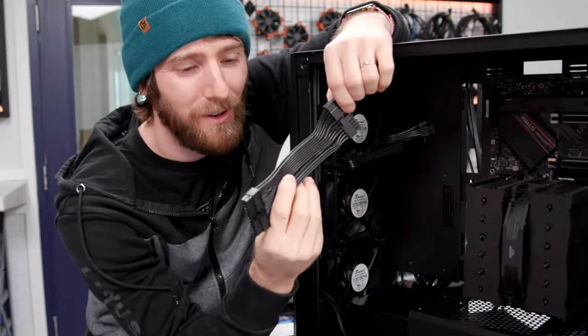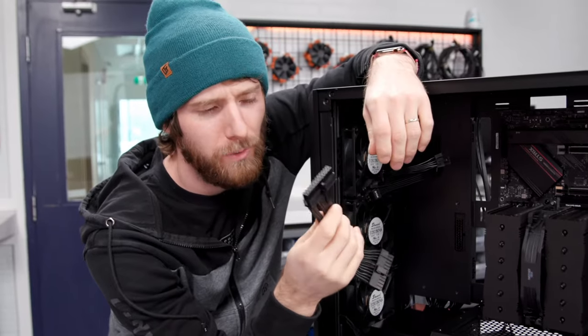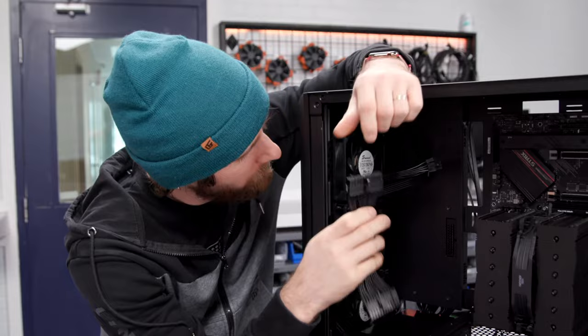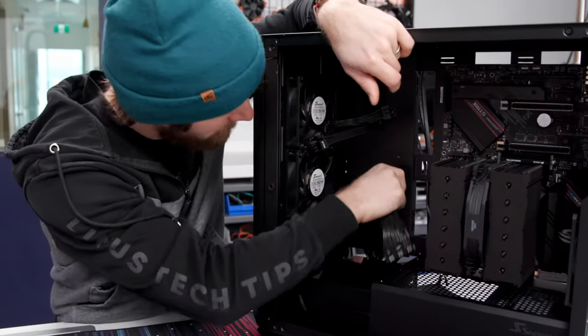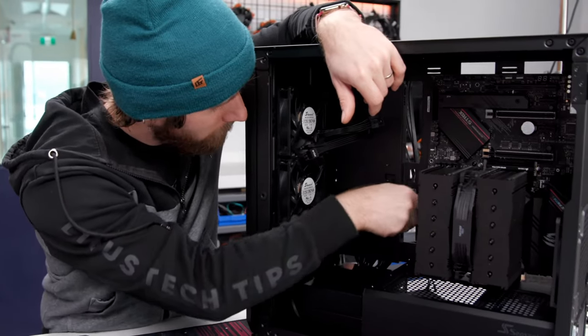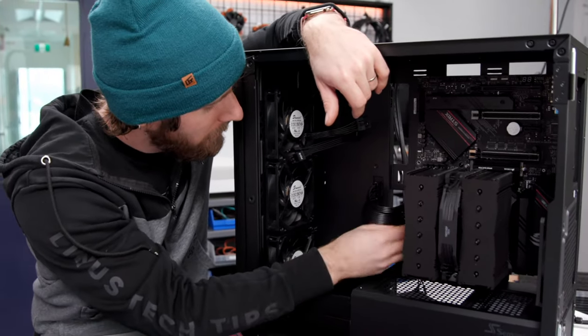All right, so let's show how this works. So my 24-pin power connector for the motherboard, so that's got 12 volt, 5 volt, 3.3 volt, minus 12? I think so, minus 12 here, whatever. Point is, plugs in there. Little adorable connector, it goes right over there. Oh, well, it's gonna try and go right over there.